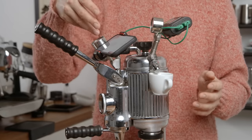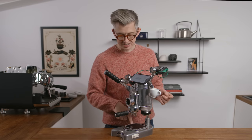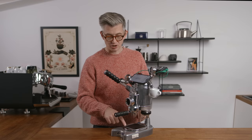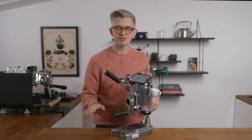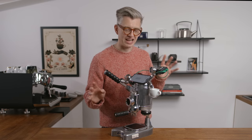The second thermocouple is super interesting — it runs down into the group head itself, giving you a very clear temperature gauge for brew temperature. That tells you exactly what's happening as your shot is pulling, and it's been revelatory. Up here is my phone running the software where I can see the temperatures and pressures. It's connected to an Acaia scale, and Gabor did a super little 3D print mod to hold the Acaia scale in the drip tray. The original drip tray is unharmed.